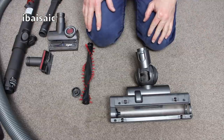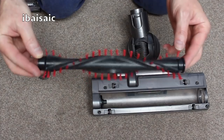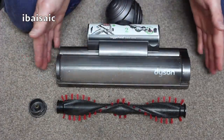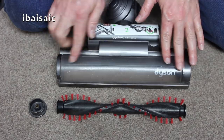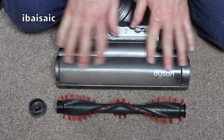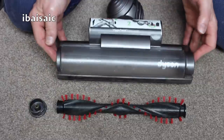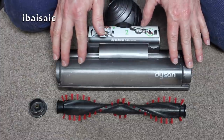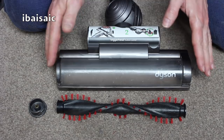I've cleaned all the parts, I've cleaned the vacuum itself, washed the filter and cleaned what I think was the worst part of this vacuum. I've cleaned the brush roll and I've also cleaned the turbine head. Here's the Dyson trigger head looking a lot better than it did a few moments ago. Now there's not a lot I can do about the plastic here — it's clean, but it's gone cloudy and that will happen after only a few uses. Any transparent parts of most vacuum cleaners, if they're in contact with dirt and especially grit, they will soon start to look like this and they'll go less transparent. The same applies to the bin. You can get specialised plastic polishes to improve that, but most people won't be bothered how it looks as long as it works better, and it certainly will work better after all the things I've done to it.